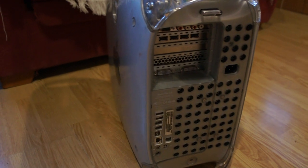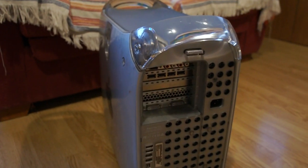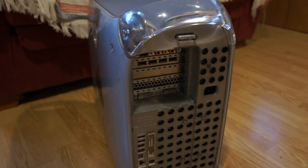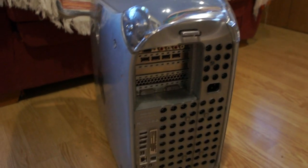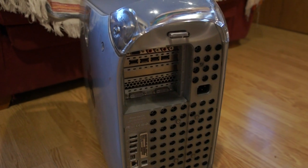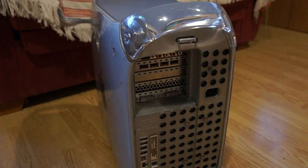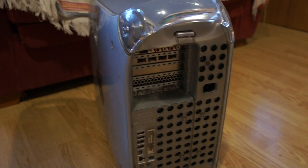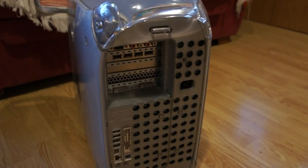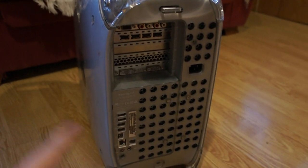That one time was to upgrade the hard drive in my iBook G4, which has Firewire target disk mode. I imaged the drive from another computer via Firewire because I didn't want to redo the Debian install I had in there, then swapped the SSD and re-imaged the thing.